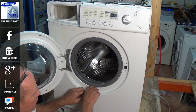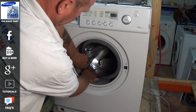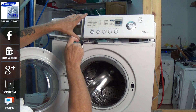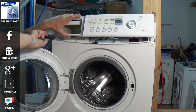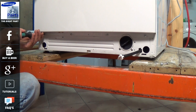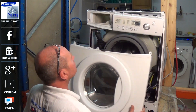First, remove the door lock and peel off the seal. The door seal has a little retaining band which you need to take off, then the seal peels off the front panel. While removing the front panel: if you need any parts, you'll need the full model number and sometimes the serial number, found around the door area or on the rear of the machine. Do not assume the number on the facial panel is the correct model number. Then remove the three screws at the top, replace the bung on the drain hose, and undo the four screws along the bottom — this varies model to model. Lift the panel up off the clip and it comes away.